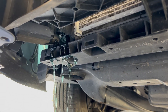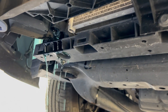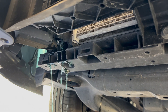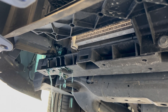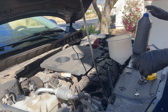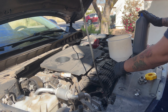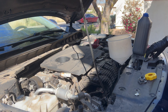As you can see, there is some blue that came out — I let it drain and made sure everything was good, but obviously there was more of the original coolant still in the system. At this point I've done it three times, driven the car after each fill with distilled water, and drained it again. Now it all came out clear.